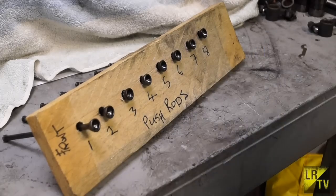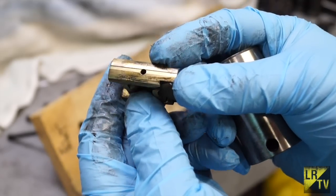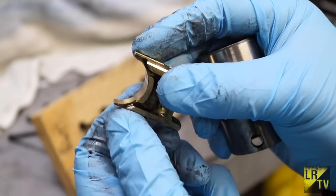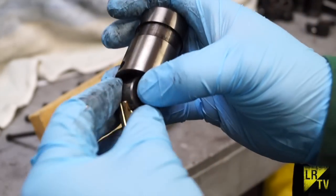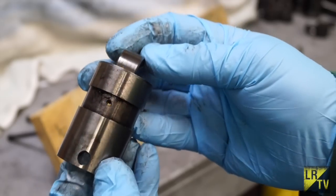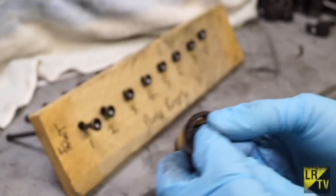Keep the push rods in order as usual. At the bottom of the push rods you have your cam follower — the brass piece is the one to pay most attention to, making sure it's not damaged or badly worn. Damage will show up as cracks where the push rod contacts it; this one doesn't look too bad. The cam follower roller and the area it runs in generally don't cause too much of a problem — they just slide up and down in the housing. As long as there is no evidence of cracking or bad wear they should be okay; if there is, replace the centre brass piece. Keep them all in order and don't swap any parts around.